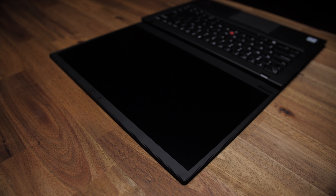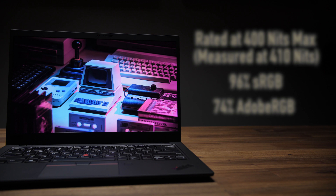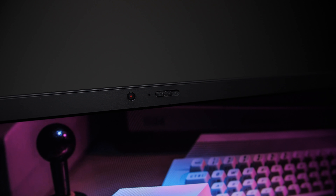There are five different 14-inch display options to choose from. My review unit is outfitted with a low-power 400-nit 1080p IPS panel — it's a bit sweet and sour. It's got nice color gamuts and great max brightness on a 60Hz panel, but the response time is slow, so you'll see a fair amount of ghosting if you're scrolling fast or whipping the cursor around. Reviews on the QHD and UHD models don't seem to have that issue, so it might be worth the upgrade.